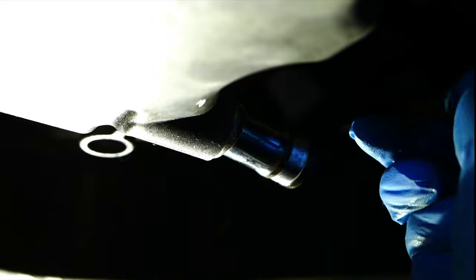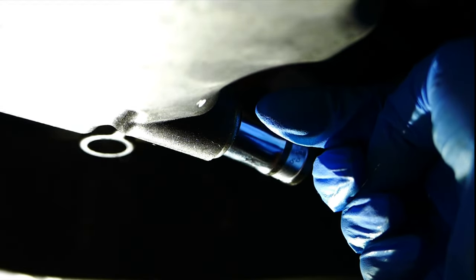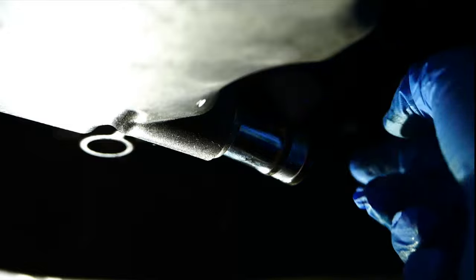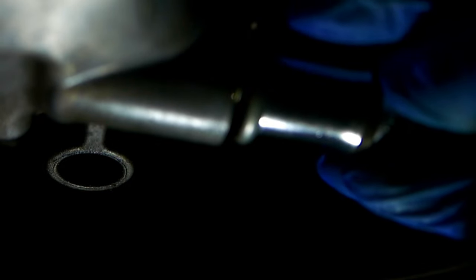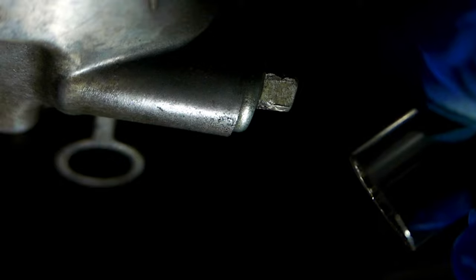There it goes. You only need to loosen it, then you can unscrew it by hand. As long as you're pushing it towards the oil pan while unscrewing, it doesn't leak — at least this Ford Explorer doesn't. You can get it quite a ways off before it starts to drip, so you can more confidently yank off that hot bolt and try to stay out of the way of the hot oil.